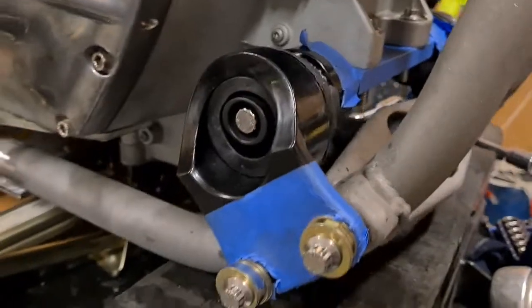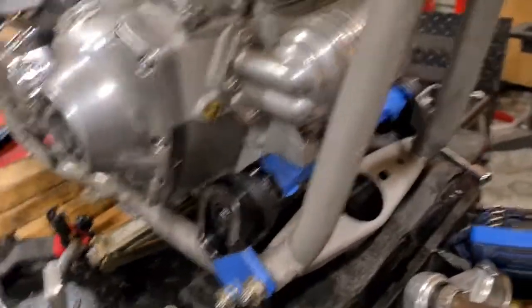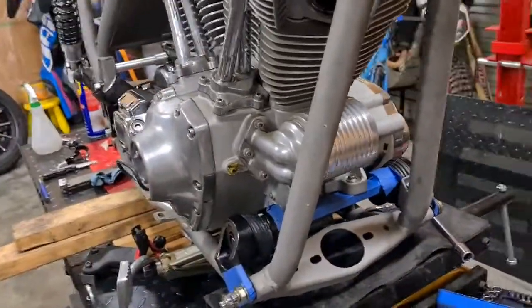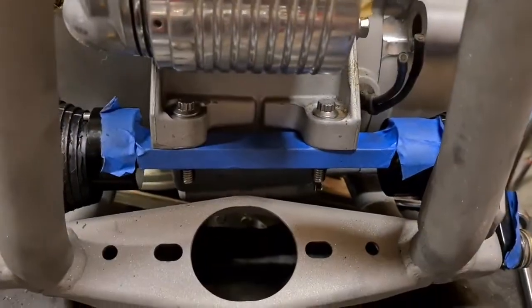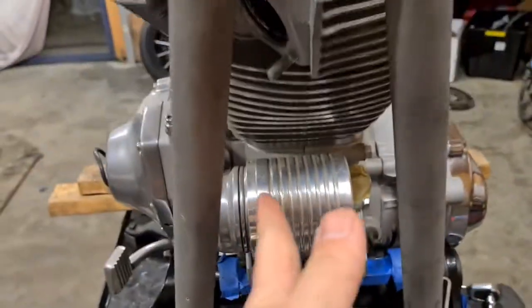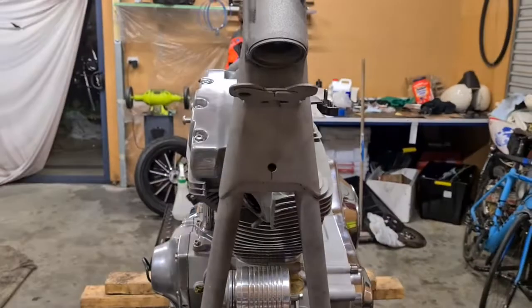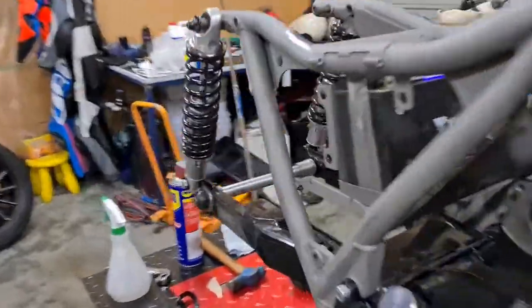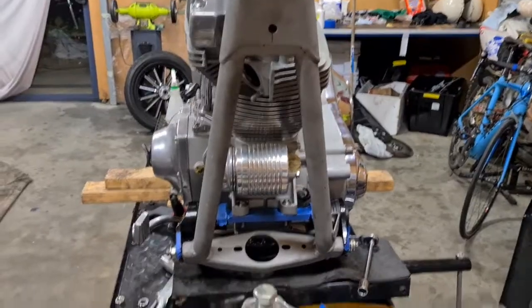I'm running a Chopper House front motor mount - real nice bit of gear. I know it won't be everyone's cup of tea, there are pros and cons, but I'm keen to try it and I can see the benefits for what I'll be doing with this bike. One disadvantage is you don't have the ability to run a mid linkage to true your frame up. In saying that, from what I can tell so far it looks bang on. You don't really know until you get the swing arm on, get the wheel on, and get a laser lined up to check alignment, but I'm pretty confident it'll be fine.